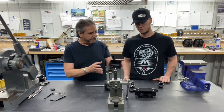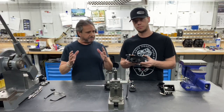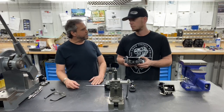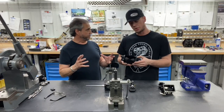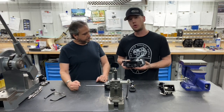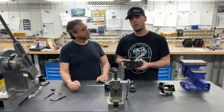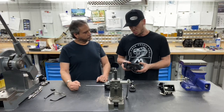What Joe's going to bring up now is a float bowl they've been working on — I've only seen it in bits and pieces — but this is a float bowl designed for power adder applications. Once you get past 1,300 horsepower with a power adder you better start thinking about keeping the fuel bowls full. This leans mostly into boosted combinations; we run these in a 4150 blow-through usually above about 1,200 horsepower regardless of fuel, and in a dominator or 4500 flange carburetor typically above about 1,400 horsepower when we go to methanol.